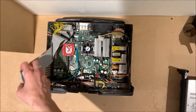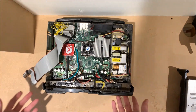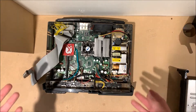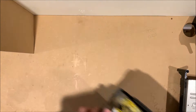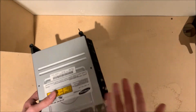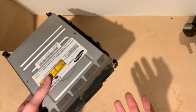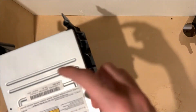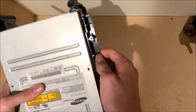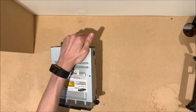So I've now blown out the fans and stuff like that as best I could with compressed air. It's still a bit dusty here and there, mainly on the plastics. Once it's pretty much all together I'll give the plastics a good wipe. So now I'll put the board off to the side and bring in this DVD drive. Like I said, this is all untested — I don't know whether this works or not. To give it the best chance of working, I just need to clean the laser and make sure the gears and stuff are running right. So I'm going to take this disc drive out of the black caddy.